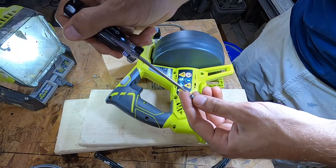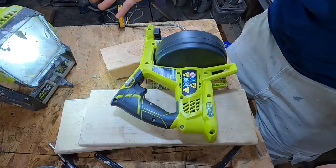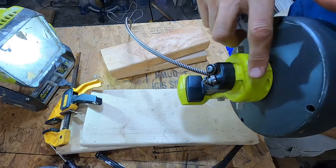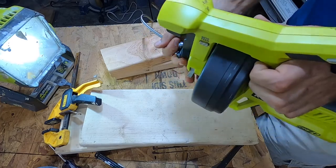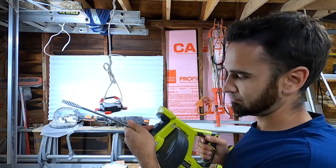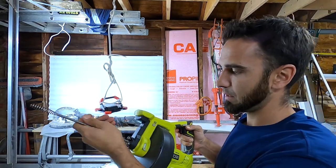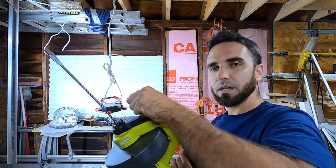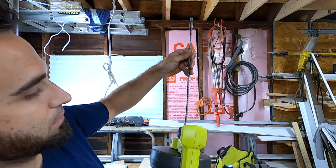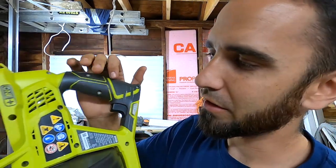I currently have all the screws in. I'm going to release my clamp over here, double check that everything's tight, and feed all the cable in. Now the only thing to do is test it out — reverse, forward, clamp works, and then the only thing left to check is the auto feed. You actually pull up on this and then push that black thing in. Congratulations, you just replaced your cable in your Ryobi drain auger that they say is not replaceable.